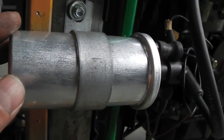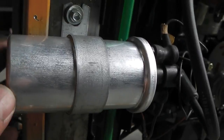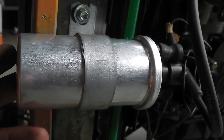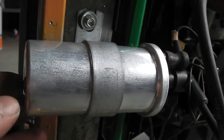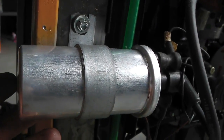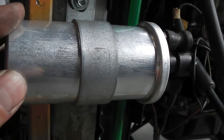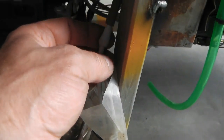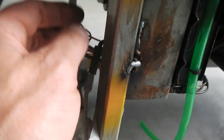So a 12 volt coil would then only be running on 9 volts, only when you're cranking, of course. You'd be all right if you weren't cranking, you could use it. So if you bump start your car, you could do it. So what they did was, they used a 9 volt coil, going through a ballast to make the 12 become 9 volts, or it's really reducing the current, but in simple terms.